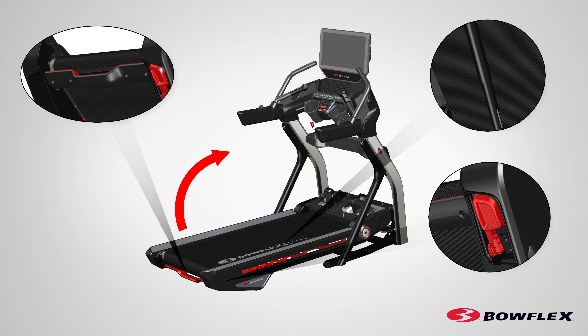After removing the left pivot cover, raise and fold the treadmill. Make sure that there is safe clearance around, on, and above the treadmill. Make sure there is no object to spill or cause blockage from the fully folded position. Be sure there is adequate height clearance for the raised deck. Using the deck handle found below the rear of the walking belt, push the walking deck release button and lift the walking deck fully upward and engage the hydraulic lift. Be sure that the hydraulic lift is correctly locked in place. You will hear an audible click when the hydraulic lift shifts into the locked position.